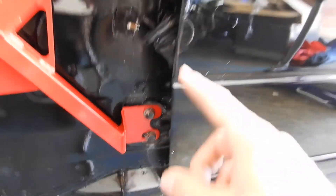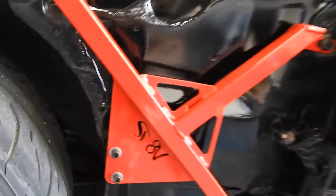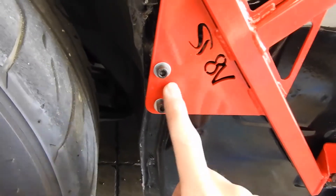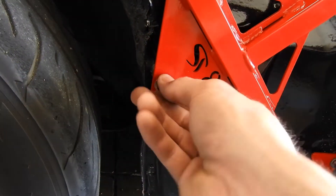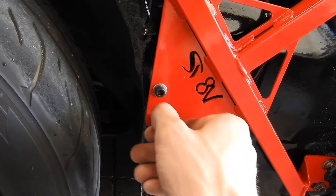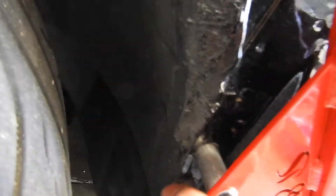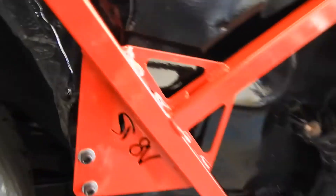Alright, so that's what we did - two bolts there, the one bottom bolt for the door hinge, and there are two spacers that the kit comes with, with some included hardware. There are two 10mm bolts right here in this location - you're going to take those out, put the spacers on the inside of the gusset, two spacers there, and then bolt down those Allen bolts there.